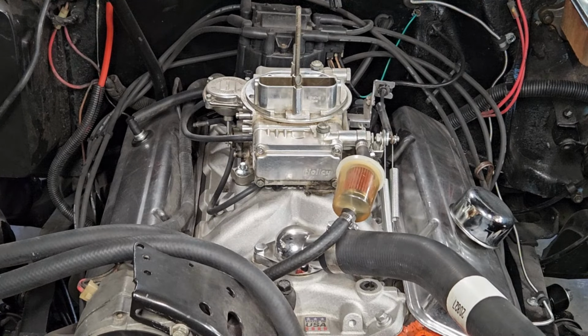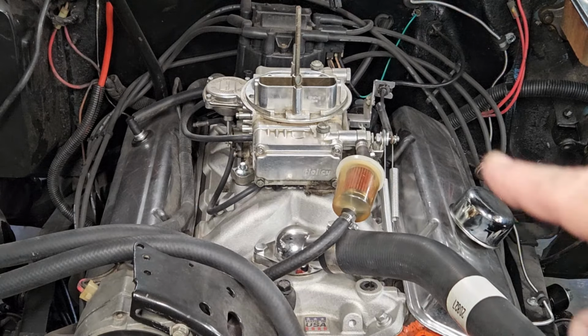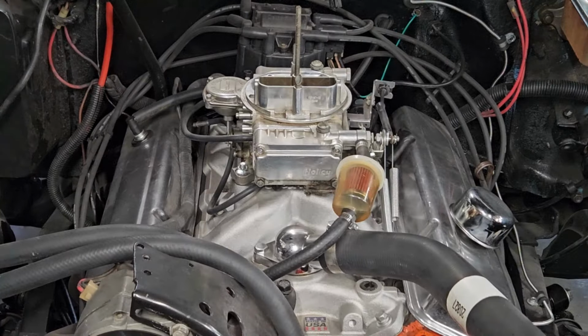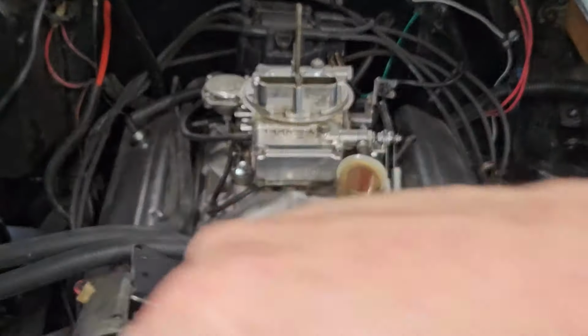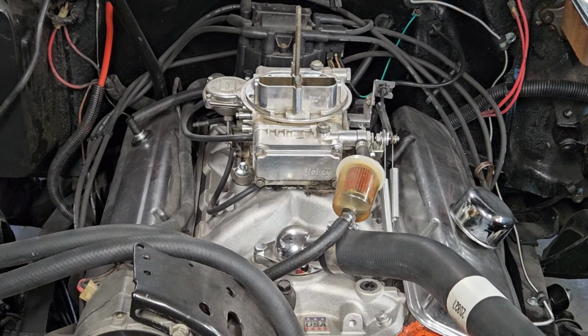Okay. Now, this doesn't make any sense. Unless we're not dealing with an ignition problem, unless we're dealing with a carburetor problem. But I was on an incline whenever I stopped. It was going downhill, and it just, maybe we need to check the bowls in the carburetor. Maybe it just got starved. Maybe it got flooded, lack of fuel. Don't know, but that doesn't make any sense.